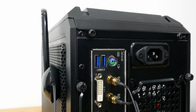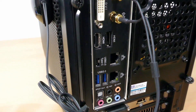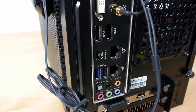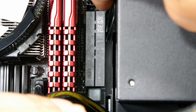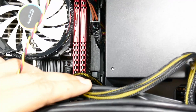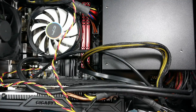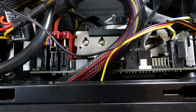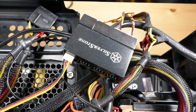Overall, my thoughts about this motherboard are mainly positive. Keep in mind that I am not planning to overclock — if that's the case for you, maybe check out the Z170N Wi-Fi instead. However, there are some drawbacks. I wish the SATA 3 ports on the right-hand side faced upwards rather than to the side, as they're inaccessible due to the lack of space in my PC case, though it depends on your case design. Another drawback is that it provides only one case fan header, but my solution was to get a fan splitter — not a very big deal.